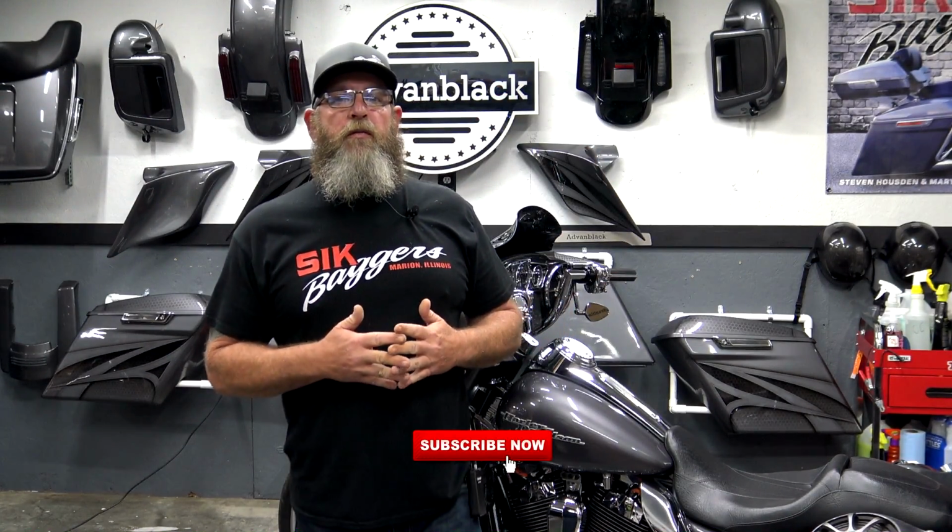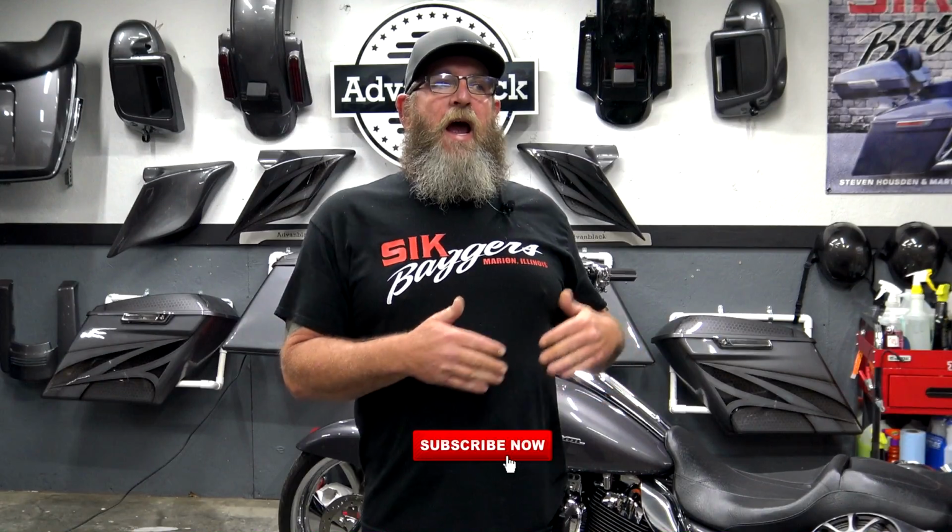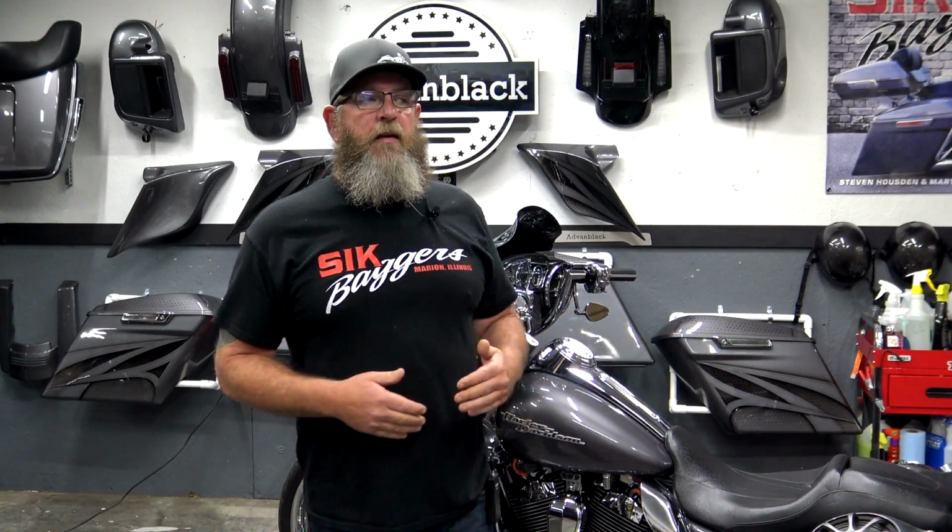Historic codes are stored for up to 20 cycles after the problem has been fixed. Say that you fix the issue and you don't clear the codes, it'll stay in there until there's 20 error-free cycles of your bike, and then it will remove itself. So an example of some historic codes would be like when we were changing bars on the black bike over here. For some reason or another, the ignition got turned on to the on position, and man, it threw a butt ton of codes.